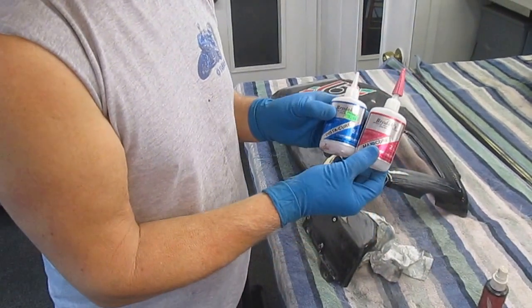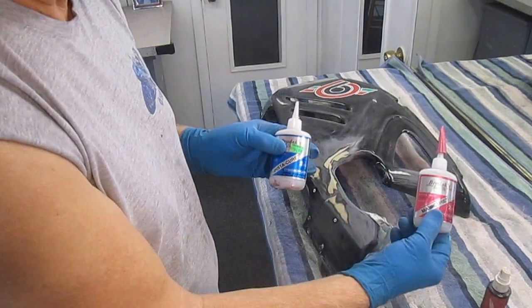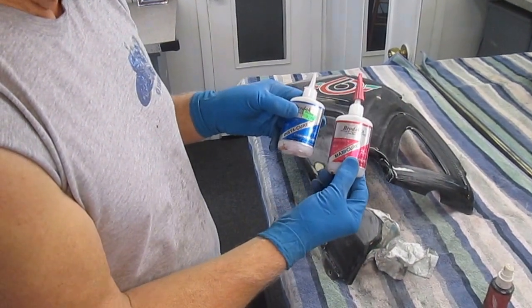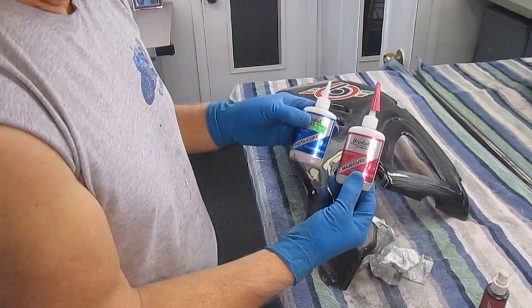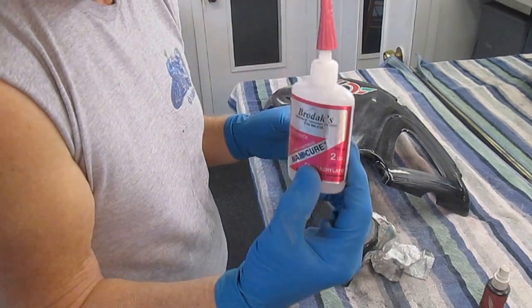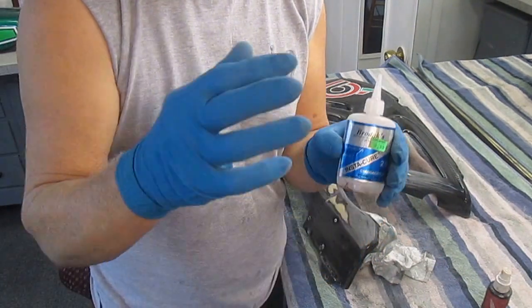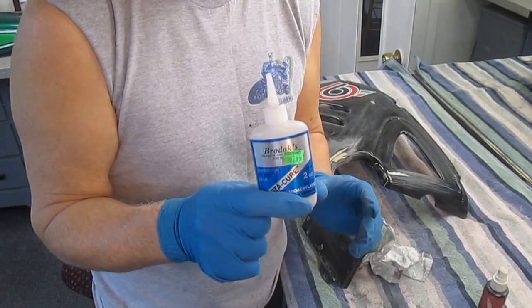It actually comes in about 10 different varieties, some for plastic, some that don't melt plastic, but the ones that we use come in thin, medium and thick. The blue is thin, the maroon is thick. We've used the thick to do carbon fiber work, and that's excellent, by the way. The blue, which is the thin, is used for a lot of things, but one thing is that the blue is capillary.